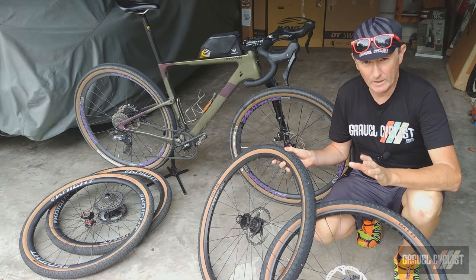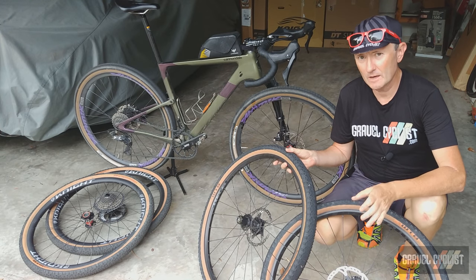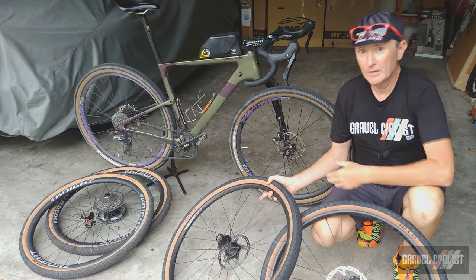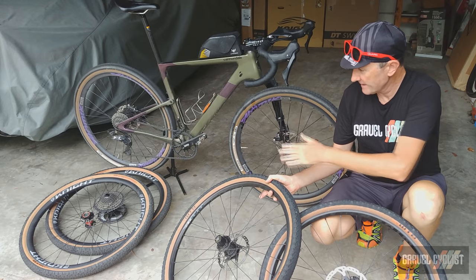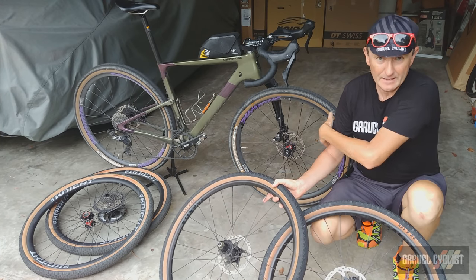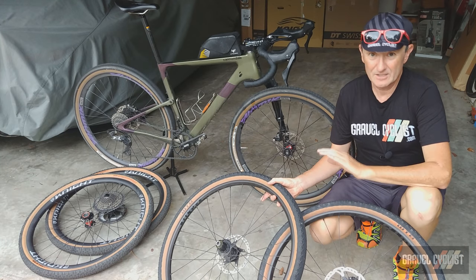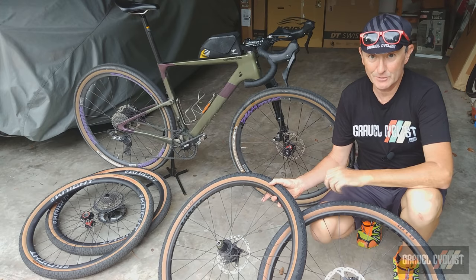The other highly annoying thing about this bike is Cannondale's propensity to shift their drivetrain and rear wheel by six millimetres to the right. That means not only do you have a specialised front wheel for this bike, you also have a specialised rear wheel. Any wheelset for this bike is effectively orphaned — you cannot run them on any other bike. The Niner MCR9 RDO, another full suspension bike I've reviewed, has none of those problems. You can ride any wheelset you like, so it's definitely something to consider.